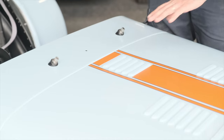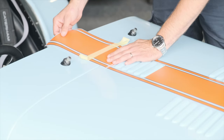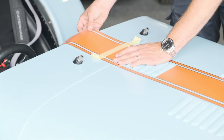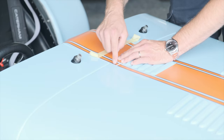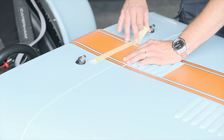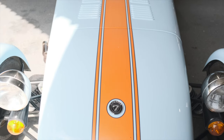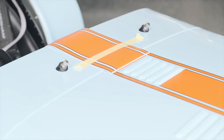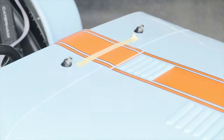Before pulling the protective cover off the stripes, we're going to line up the scuttle. Pop your bonnet back on and you should find the stripes have lined up beautifully. Then line up this last bit — looking at the stripes you can see where they'll match at the front. That doesn't mean we've got it straight yet, so tuck it in place and then peer down the line to make sure it's running true. Then we're just going to fix our anchor.